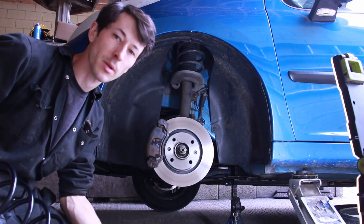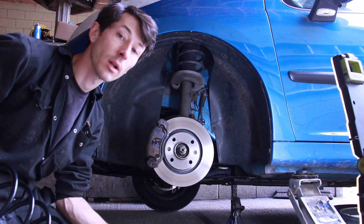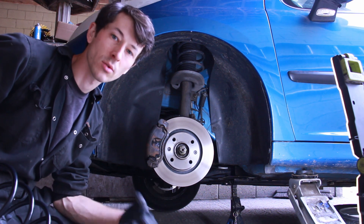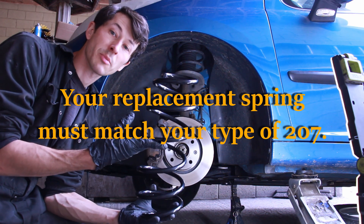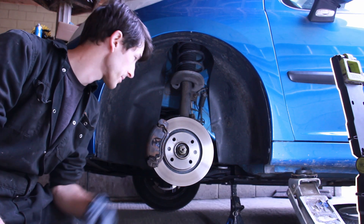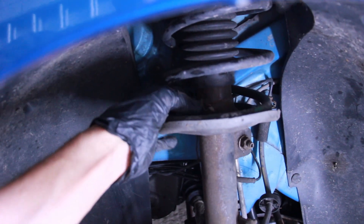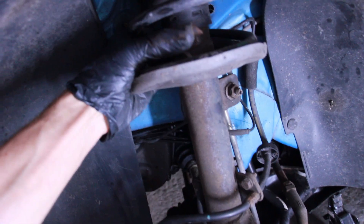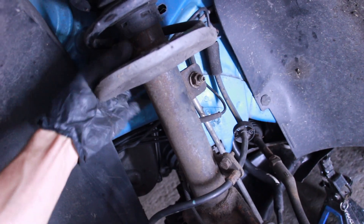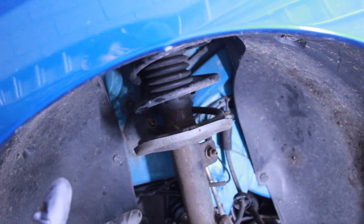On the Peugeot 207, the structure is all pretty much the same no matter what the engine, and the basics of removing certain items in a certain order are again the same no matter what the model — estate, diesel, petrol — all pretty much the same. We're putting in a nice new spring today. I'm presuming you've already got the vehicle jacked up and safely positioned on an axle stand with perhaps a backup as well. Let's show you why we're going to do this; maybe this is a problem you've experienced too. You might be able to see in there — the coil spring's actually snapped. This results in lower ride height on one side and a knocking, an obvious knocking usually, and sometimes a creaking or even a crack occasionally as the spring splits, turns around and jumps on the bottom seat. So yeah, the vehicle's up and safe, let's show you the tools you're going to need.